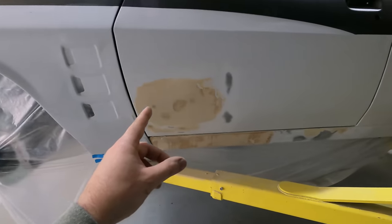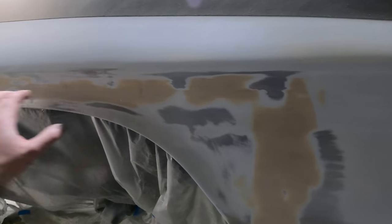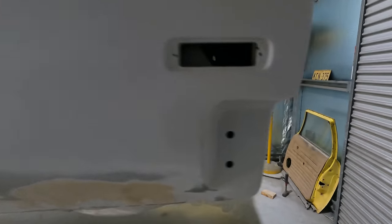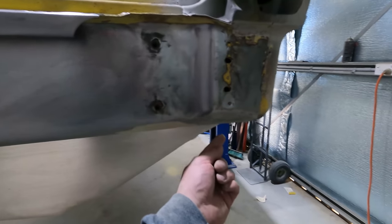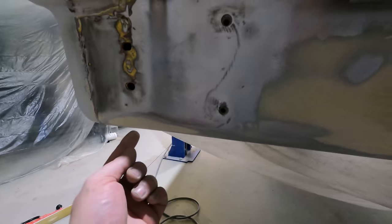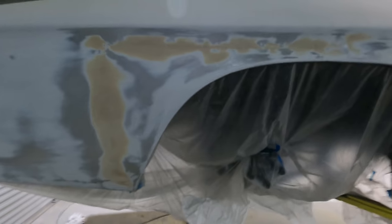Just posting an update on where I'm at now - I'm slowly bogging in all the dings and sanding. I'm going to have to put a layer across the bottom here, I was hoping I didn't have to but it'll just make it easier doing it now. There's a bit of a high here so I'm going to have to try and blend bog back into here. In the middle I ended up having to use a slide hammer and weld tags on. There's a ding down here and one down here, I pulled them out, and there's a few tiny rust holes down the bottom I had to weld up.